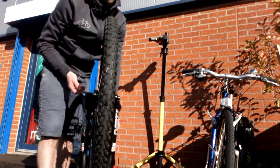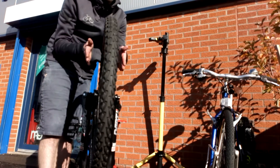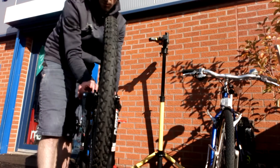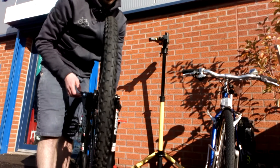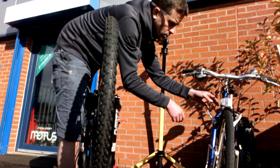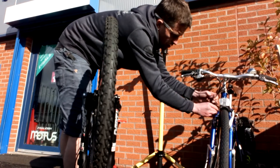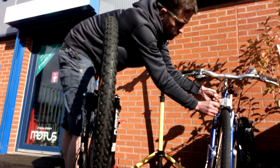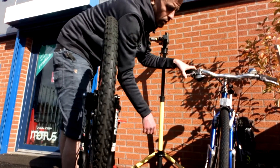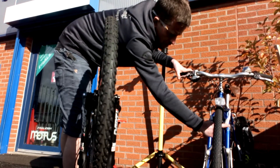The last thing to do is spin the wheel, make sure it's aligned in the fork correctly, and make sure the rotor is aligned in your caliper correctly — and that is you. If you've been using V-brakes, just remember to reattach your noodle into the cradle, and check again that your wheel is aligned in the centre of the forks and in the centre of your brake pads.